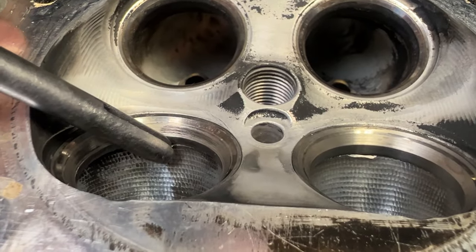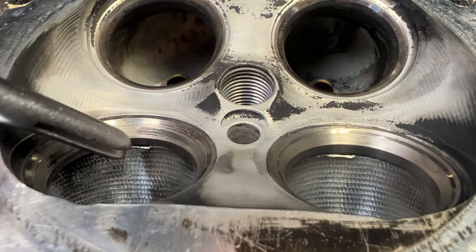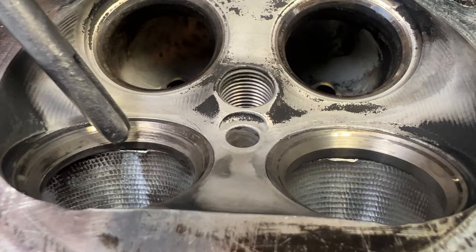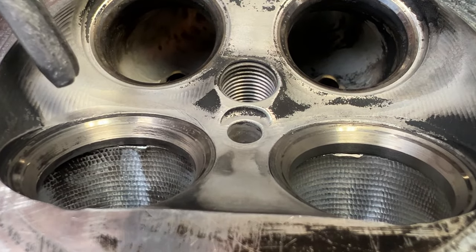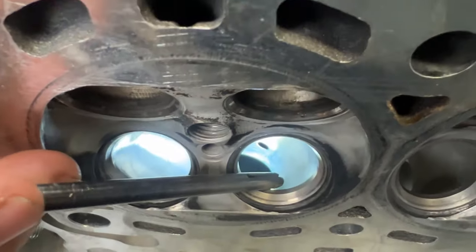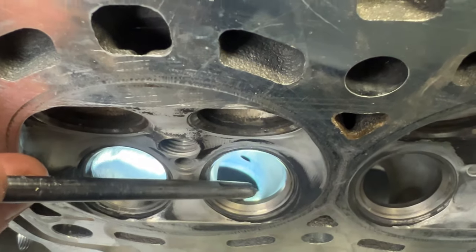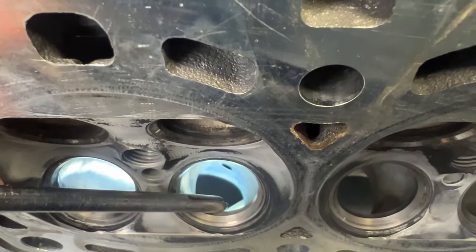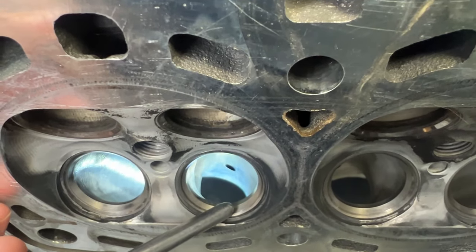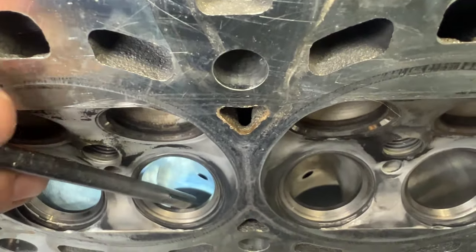This is scary — that guy thought he was doing right, charging thousands of dollars to go backwards. You'll see here this little spot right here — it's in all of these. It looks like they took a punch or a screwdriver, pulled the factory seats out, installed a different valve seat, and then didn't size the throat diameter to the CNC port. On the other side of the short turn, because the valve seat was not sized to the correct inner diameter, there's a gigantic step from the short turn to the bottom of the valve seat. So you have the 45-degree angle, then another angle, basically a 90-degree angle, and then a huge step on the back side of the turn.